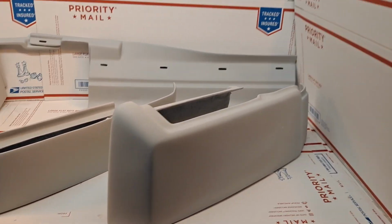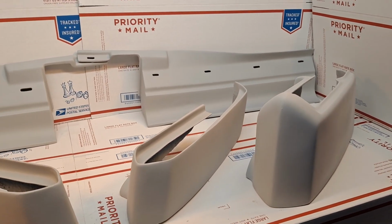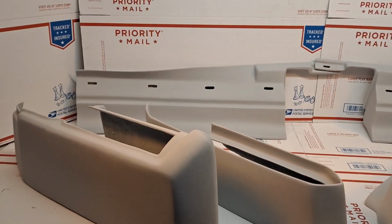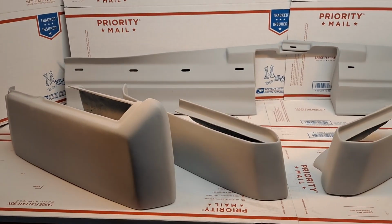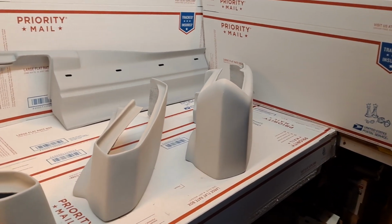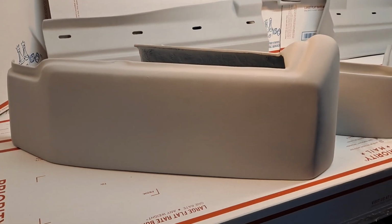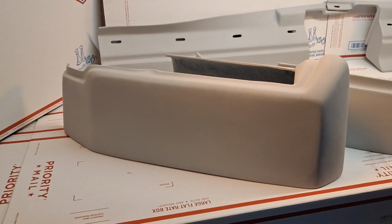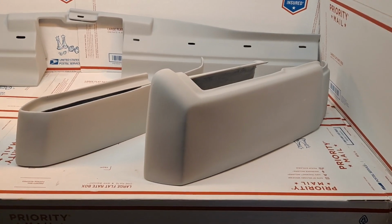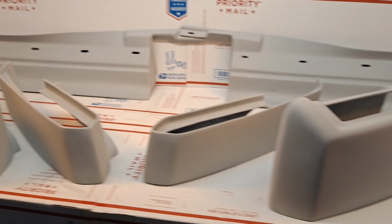Whereas a malleable surface that doesn't have that hard shell finish would model or shade in the colorizing very shortly after being painted. Even if being painted at the same time as the entire car, you wind up getting shade modeling, differentiating between the substrate surfaces of the steel body and the filler extensions. So with these hard shell coated filler extensions, which I provide, we have high matchability to the color of the original General Motors paint coat.